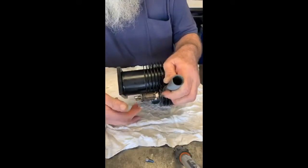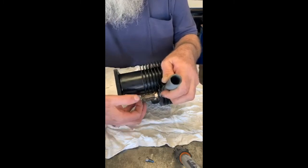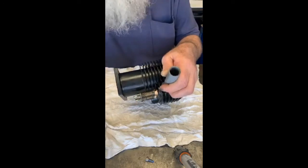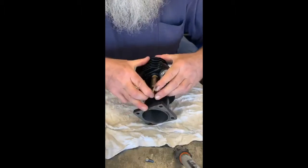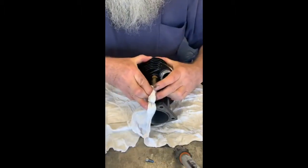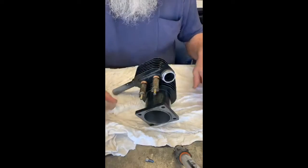You can see the keepers and the springs clearly — those washers, springs and all that are the original stuff. I measured the compressed height before I took all the old stuff apart so that I knew the compressed height of the springs. You can see I'm opening and closing them with my fingers, which is pretty funny because you never do that with a modern motor.